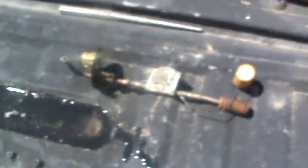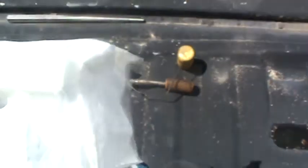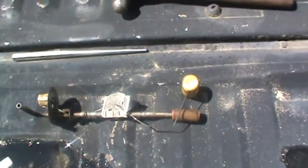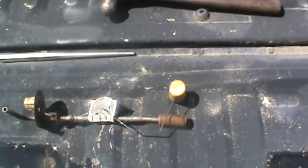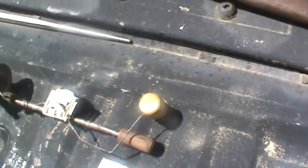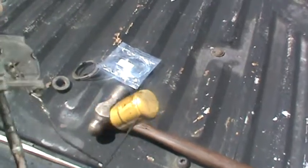I got my sending unit out of the tank and I'm going to replace it with a plastic float, because the brass ones are known to have pinholes in them and if you sink a float your gas gauge isn't going to work. For an 84 Ranger, the part number you want is 17729.01 — it's for a 55 to 86 Jeep CJ. That float will snap in and replace the brass one, so you'll never have to worry about pinholes developing and sinking.